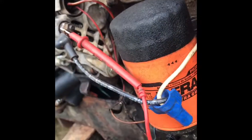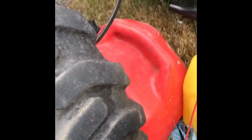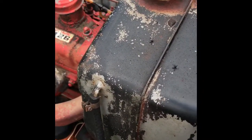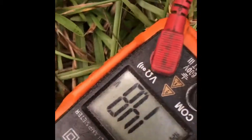I've got 14.5 volts again. Now I've got the yellow/green connected. I'm getting 14.7 volts at a medium idle. Lower down — really slow idle — that belt looks good like that. Very good output at very low idle.